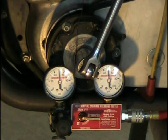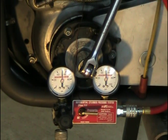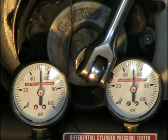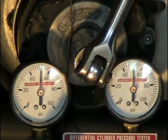There's no problem with bore wear or piston rocking or anything else on a normal street bike. Now on a race bike, high performance, you can wear out things quicker, and in those conditions I would suggest treating the cylinders with silicon carbide. For street bikes, you should be fine. Like I said, it's got 20,000 miles on this bike — same rings, same pistons — for six years. I'm very happy with this setup. I hope to get another six years more out of it.